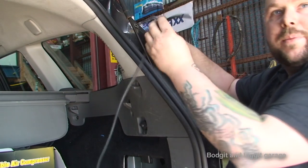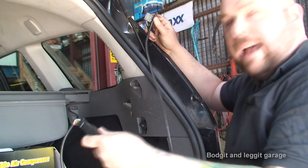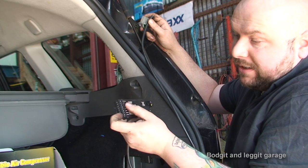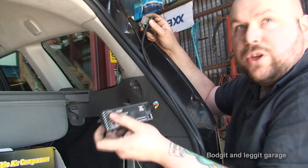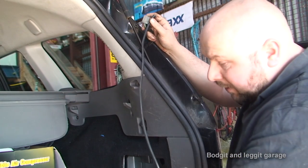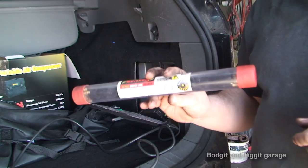What you get is a wire that clips into the box and we've got the wire that goes from the tow bar. This side has to connect to where our lights are. So we have the wires coming out of the box fitting onto our light harness inside the car, and then the wires coming from the tow bar go into the box. It's really as simple as that. It gives you the pin outs here - A is reverse.